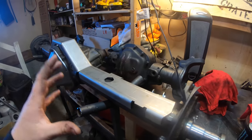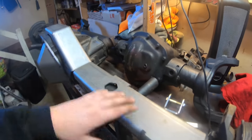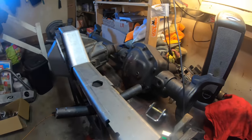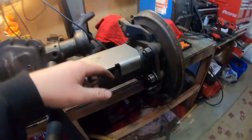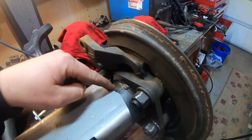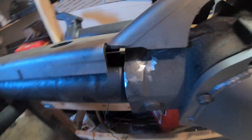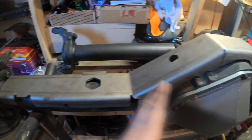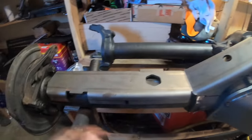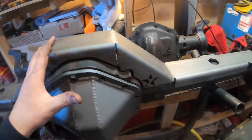It's time to start looking at the truss and setting this up, getting ready to be prepped and welded on. I've been working on this for a couple of days and had to make a few minor adjustments. To get this truss centered, you measure from the outer flange on each side to make sure it's perfectly centered. I had to actually grind a little bit of the casting right there because the truss was hitting it, preventing me from moving it side to side. I ground that down about an eighth of an inch and we're able to center it perfectly.